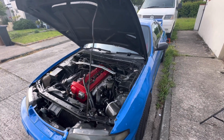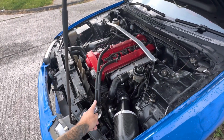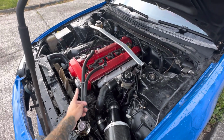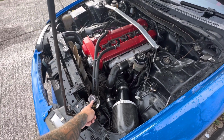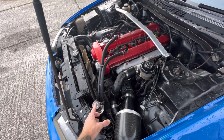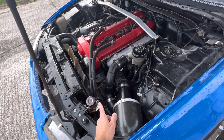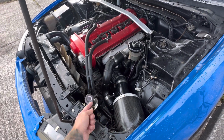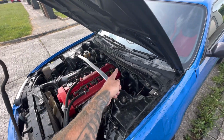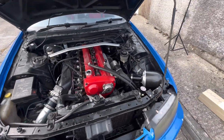And the other issue we had was just the catch can. It's fine daily driving, but when you're booting it, oil squirts at the top here, so there's not enough breathing basically. That little stupid breather there is not enough, so we're going to get a new catch can later, because we're not going racing until September. We'll go back to the Nürburgring again, so subscribe if you want to see that one again. But we're going to have a bigger catch can, and then one going back into the sump, so it's like a circuit. So it's got a front head drain, it's already got the rear head drain. But yeah, we'll do that another day. We haven't got a catch can yet. We'll get that done next.